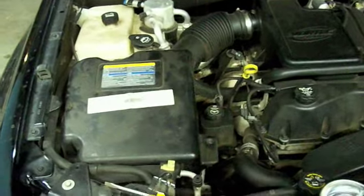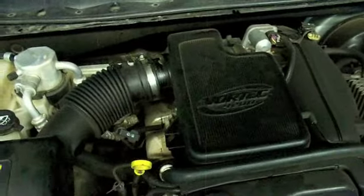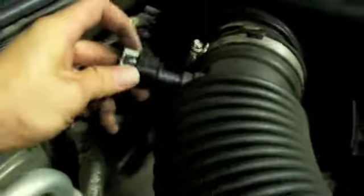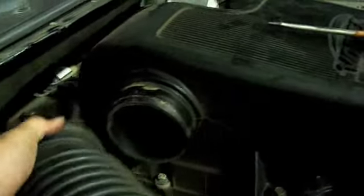All right, this is DJ Ethics. We're about to take the old air intake out and clean the throttle body. First thing you want to do is take out three screws — one here, one right there, and mine's gone, but there's one down in there. Next, it's already unhooked here — let the sensor go. You got to pop this little gray thing out and then slide it out.